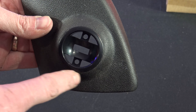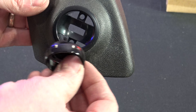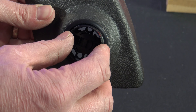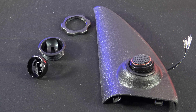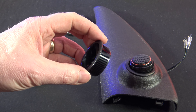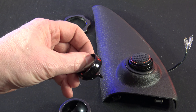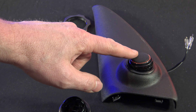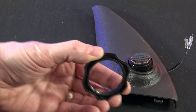As you can see, I have the perforation cut out and this fitting mounted in place. This is going to go inside, and that's going to allow the tweeter to be adjustable. Now I have the tweeter fully mounted in the molding. What I used is this front piece right here, and then I have this swivel mount so I can direct the tweeter right up towards my ear, and then you have this large nut on the back.